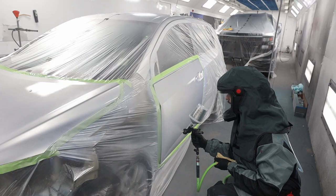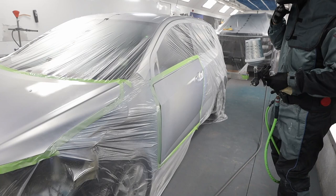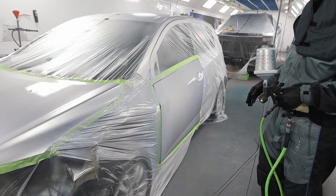I like to keep it really short at first. My control coat will come to about the middle of the door, but the control coat is a lot easier to control than these first coverage coats, because this stuff covers really fast. I always start my blend this way and then blend out, get my coverage.